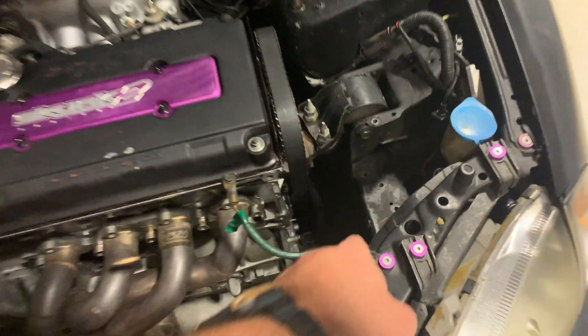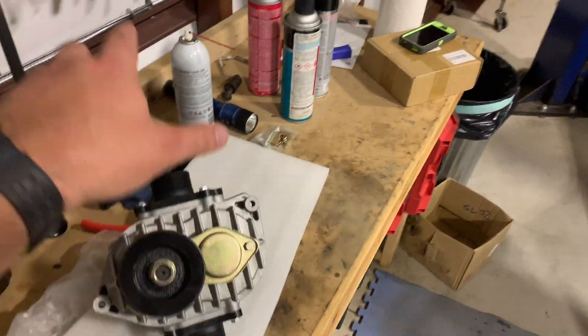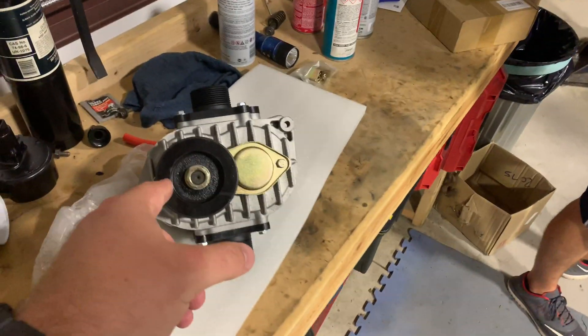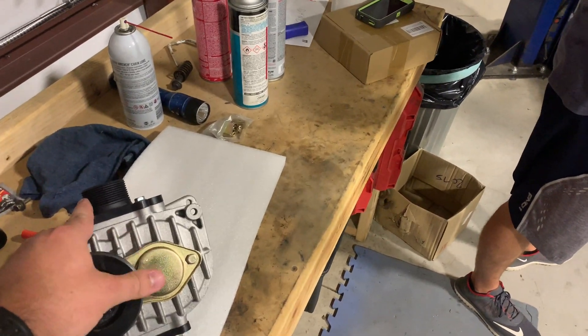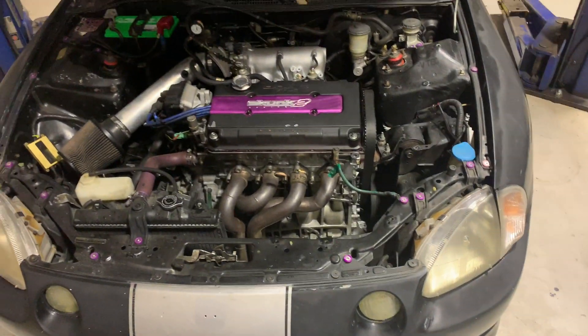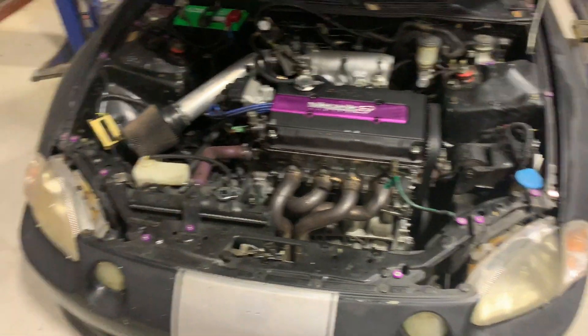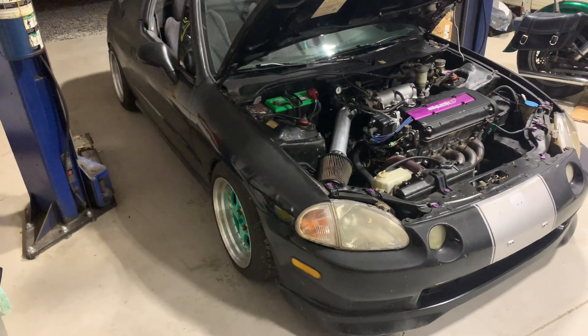On here we've got the four-rib belt and we've got to go to the smaller pulley. The maximum RPM on here is 16,000, so you cannot rev this over that. This engine revs to 8,500, and if it goes double speed at the pulley that's going to be 17,000, which is over what this thing's supposed to rev. That's only if it's two-to-one, so we've got to measure that — otherwise I won't be able to rev the engine up all the way.